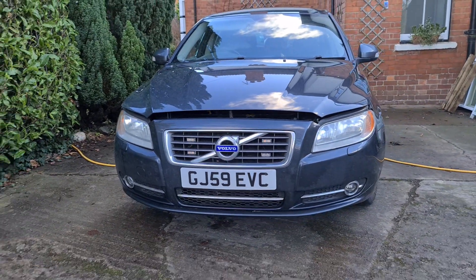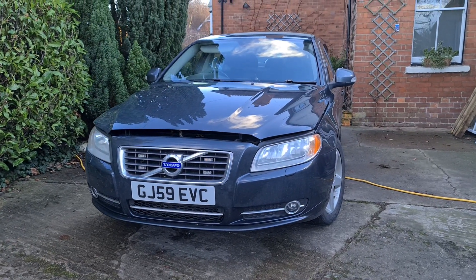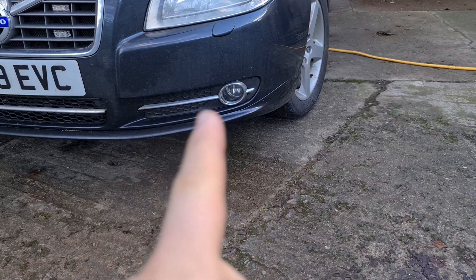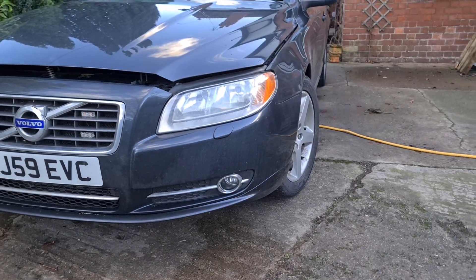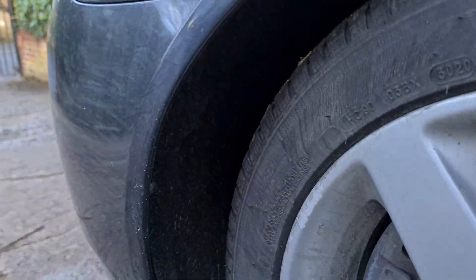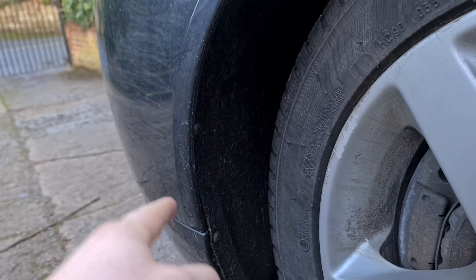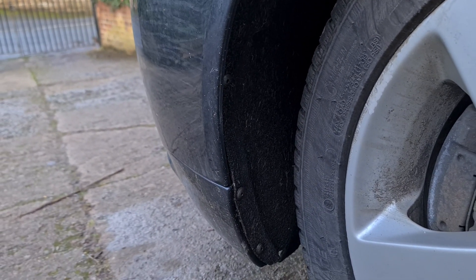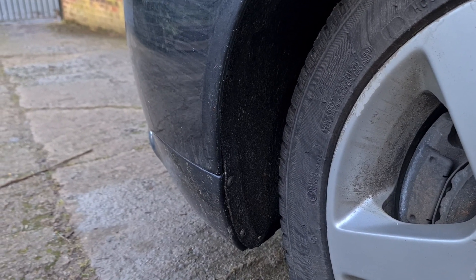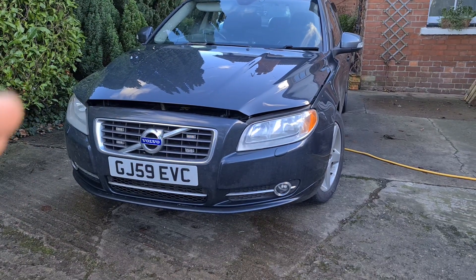This wasn't working when I first got the car. I replaced the front bumper, which was damaged by the previous owner, and then replaced the pump. The headlight washer pump is behind the fog lights, so we're going to have to remove that. For reference, the windscreen washer pump is accessed by turning the wheel and removing the wheel arch liner. The pumps are really easy to replace. I now need to diagnose what's causing the headlights not to work.